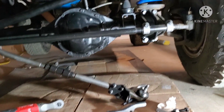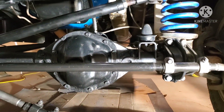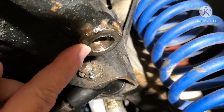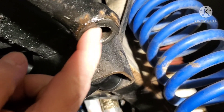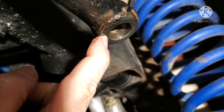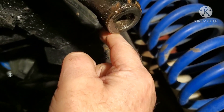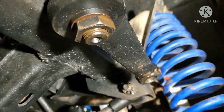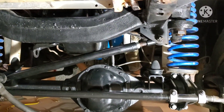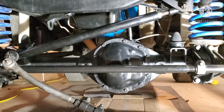So I had to grab a kit to break that off. I'm also pulling off my pitman arm — this right here is kind of wallered out, it's a little too big and it's old. The drag link was sticking too far in and I think it was actually causing some binding. So I'm going to swap this out today. I got a pitman arm puller. I won't be able to video it because I don't have a tripod small enough to get down here.